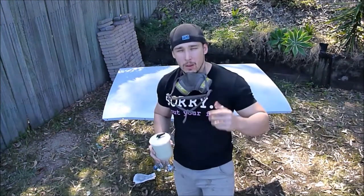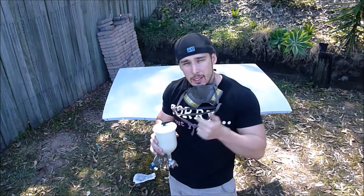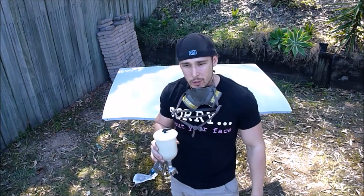All right, it's meant to be 15 minutes between coats. A total of only 2 coats with this particular epoxy. So yeah, just two wet coats. So I put on this one, wait 15, put another one, and it's done. All right, so it's been 15 minutes. It's time for me to hit the second coat, and we should be done then.